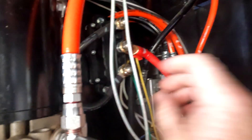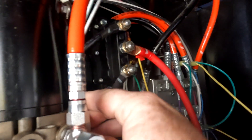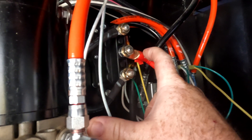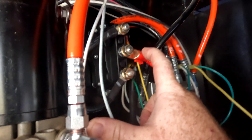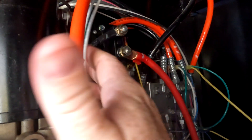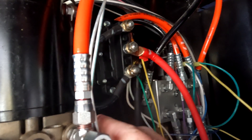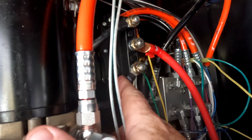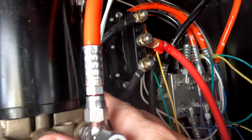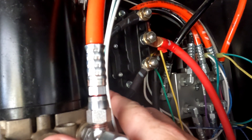Just a quick breakdown of this reversing solenoid unit. On the main side of the solenoid, there are going to be three posts. There's going to be your central post — your middle post — which is going to be your battery power, coming from your batteries or your battery turnoff switches. The other two posts are going to be going to your motor. I'll go into more depth once we get this unit out of the RV — exactly what these posts go to, how they work, and how to test them.